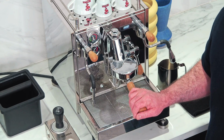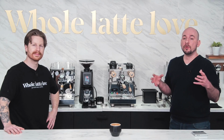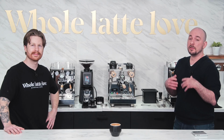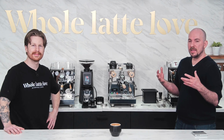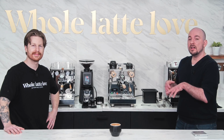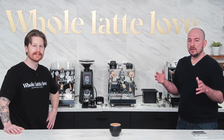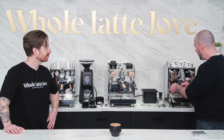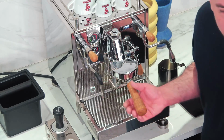So between just the ability to froth and produce a lot of hot water because of that large boiler and the ability to plumb into that water tank, which I know is one of Mark's favorite features, so you never have to refill the machine again, the Sole is designed, I would say, really to handle a lot more use. And if you're thinking about that in terms of what has more capacity for back-to-back, the copper in here too, as Zach mentioned, is actually a material that Bezzera really prefers.